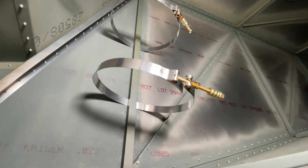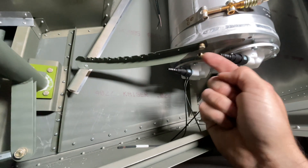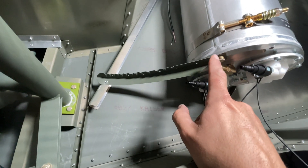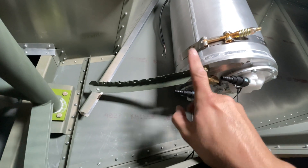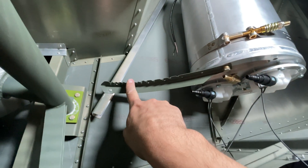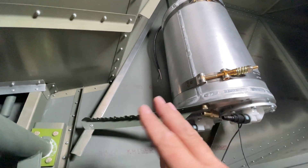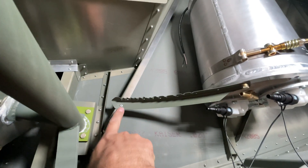The header tank is now fully installed. All my nipples are going towards the cabin. I made up a bracket that will screw into the bottom of the tank — it's an AN3, I believe AN3-3. I did put a couple of washers in there to keep it from going in too far so we don't make the tank leak. I used the L-angle I pulled from the original location, cut it to length, and attached it to the upward strut. She's not going anywhere — nice and strong. The supports keep the tank from going up and down, and this keeps it from rolling forward and back.